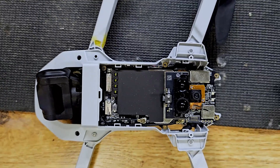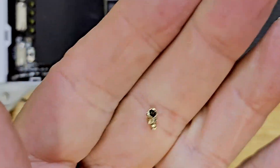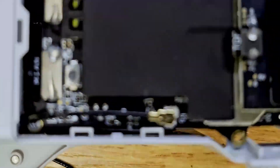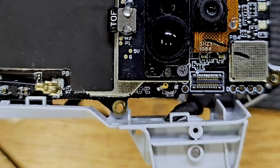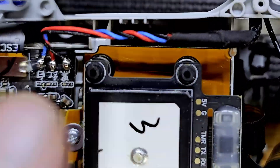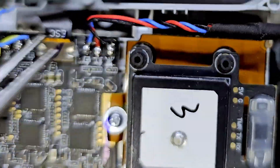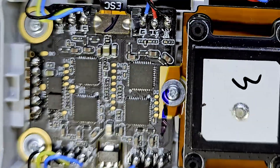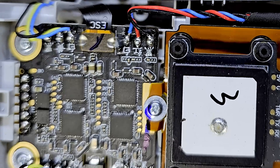So we're going to have to unhook that — just use your little pliers or needle nose. That did not go well. This little thing is supposed to just pop off, but as you can see, the whole casing of it fell off, so I'm going to have to solder that back on. I'm going to flip it over, and you see these right here — you've got a blue, red, and a black wire — and what you're going to want to do is just touch it with your soldering iron and they should pop free.